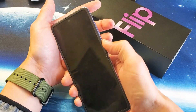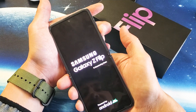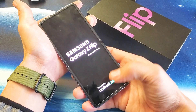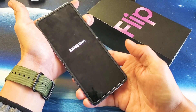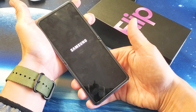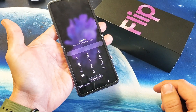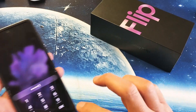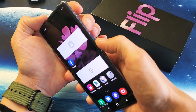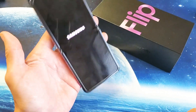Power button right here, press and hold, wait — there's the logo, let go, and now press and hold the volume down button. I'm still holding onto the volume down button; I'm not going to let go until we're actually booted up into safe mode. I should see 'safe mode' on the bottom left-hand side. You can see safe mode right here — go ahead and let go and you are now in safe mode. Pretty simple. Any questions or issues, just comment below. And remember, to get out of it you simply just restart and you'll be out of it. See you guys in the next one.